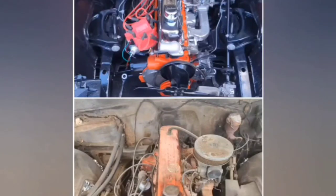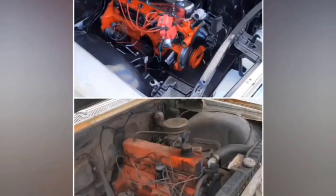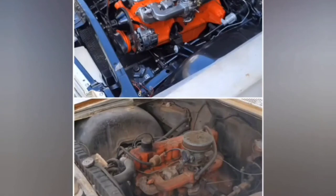My wife's uncle rebuilt the engine for me. He put a mild cam in it — I asked him for all the specs, haven't gotten them yet. He got a bigger distributor. We deleted the mechanical fuel pump and went with an electric fuel pump. I got all the chrome accessories — the side plates and valve covers — on the internet. He put a bigger carburetor; it had a little single barrel in there before, which was super small. I cleaned up all my fuel lines.